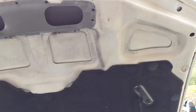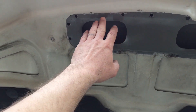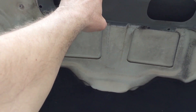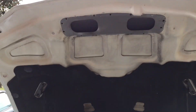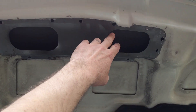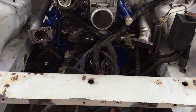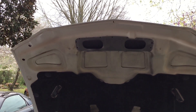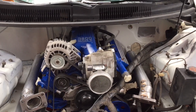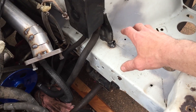The other day I started on the hood — drilled out the welds and got the hood latch off. The next step is we're gonna have to cut this area out here because my intercooler piping is going to be running right here across the support, and when the hood closes it'll be hitting it. So we'll be taking that out today. Also I'm gonna partially put this wiring harness back in.